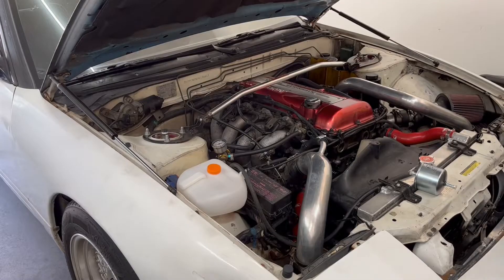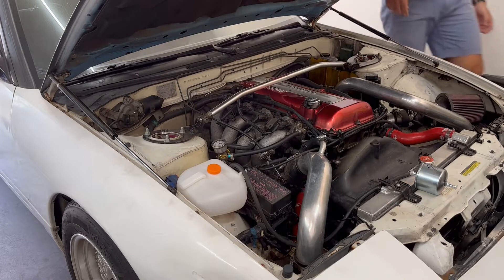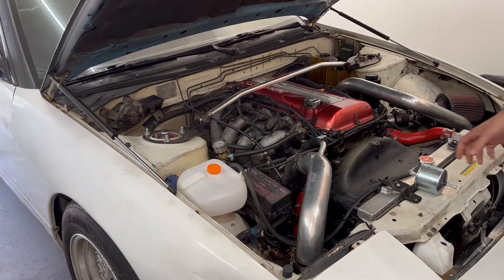I've never changed a fuel filter before, but I do know that the first thing to do is pull the fuel pump fuse while the engine is running so that you can get as much gas out of the lines as you can and relieve the pressure. Sometimes this car has a difficult time on warm starts, but never as bad as it is here. I guess it's just another reason to make sure timing and everything is set correctly. Finally got started and then pulled the fuse.